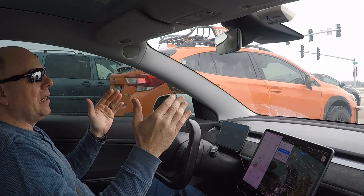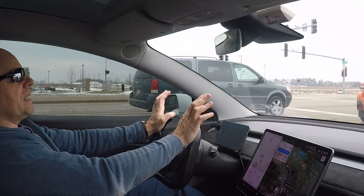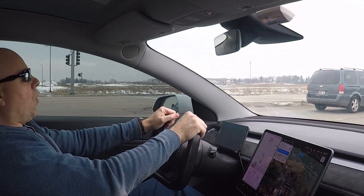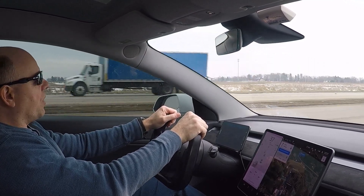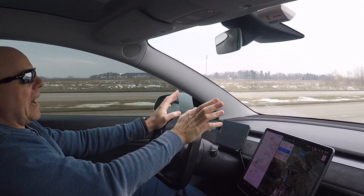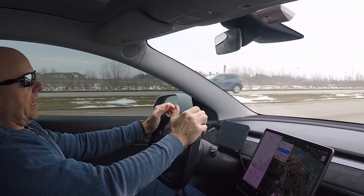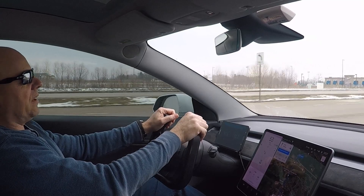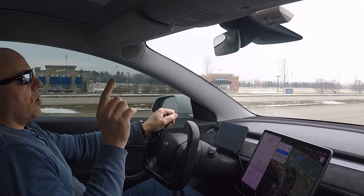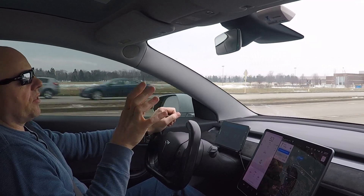The alignment tech told me the additional camber was just slight and still within the realms of what he considered normal for a street car, so not to worry about it. But he did say I may see a little bit of additional wear on the inside edges of the tires versus the outsides. A lot of people ask what the tire wear is like with the car lowered, so in this video I wanted to go ahead and explain what I found.